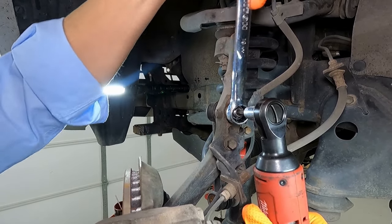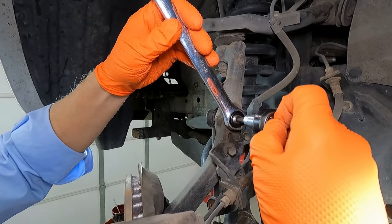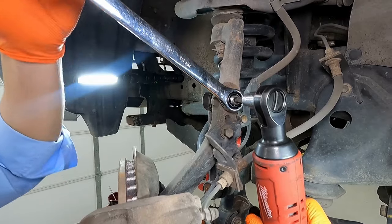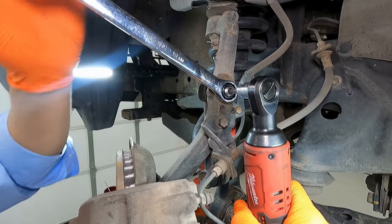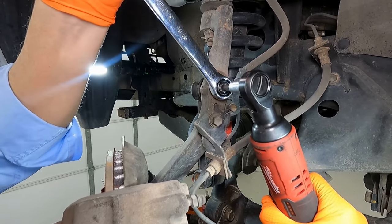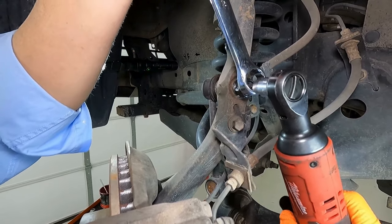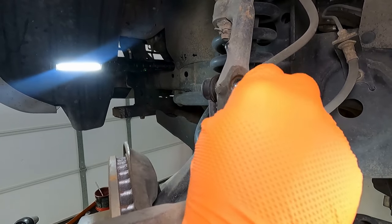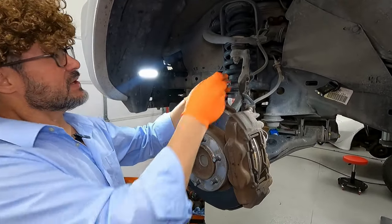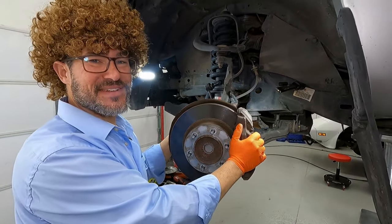See that? Once you've loosened that nut, here's a really cool part. We can put this wrench in the tightening direction, and as we tighten that stud, basically we'll be loosening this nut — there's no mistakes, just happy little accidents. There we go, just like that. Now we have our sway bar end link out. We'll go ahead and put the nut back on it so that we don't lose it. There's no way to lose the joy of wrenching faster than to lose your fasteners.